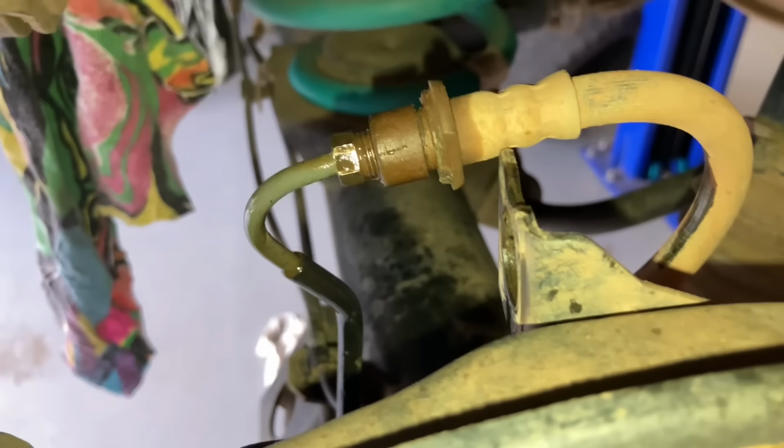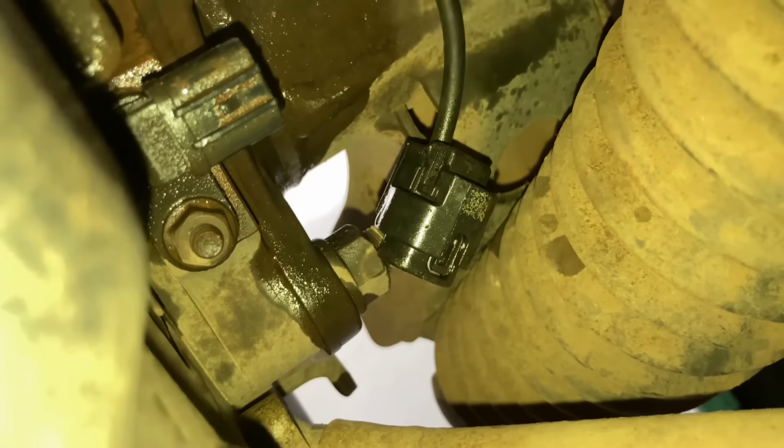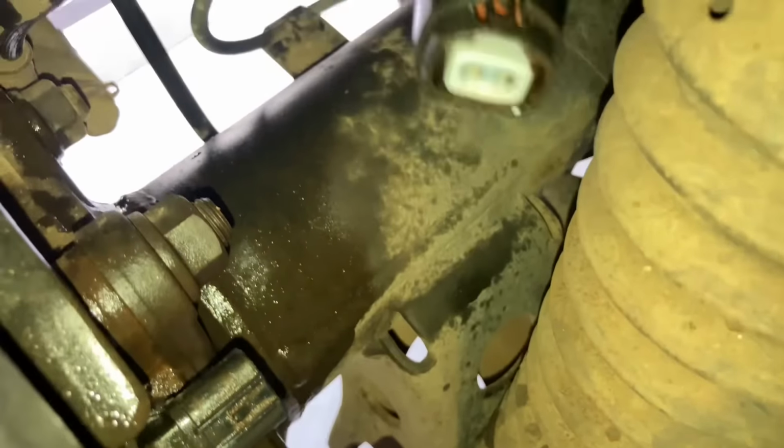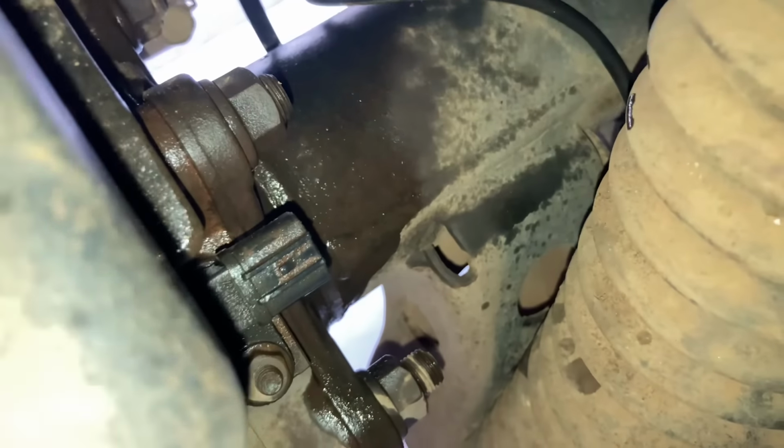And we've also put a couple of clamps on the brake lines up there to help stop the fluid coming down while it was disconnected momentarily, but I'll gravity bleed the brakes once we're done. And don't forget to unplug your ABS sensor, because as you can see it's fixed to the diff, and when you pull the axle out you don't want to bust your sensor.